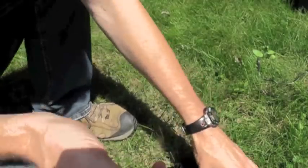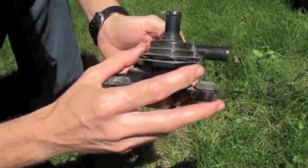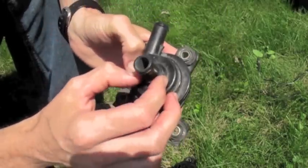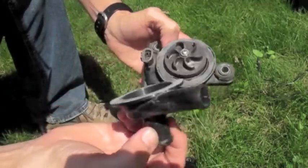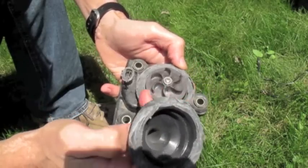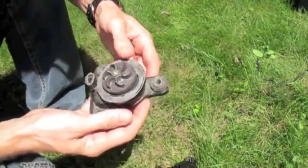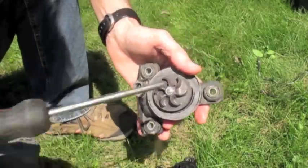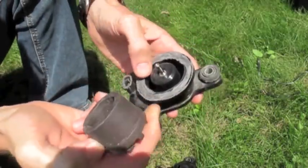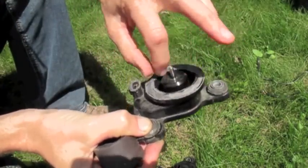Let's have a look at another one. I picked up two of them and I took one apart — I was curious as to what was inside. It's all thermally molded together so you really can't take these apart, but you can see inside there's a little screw that does hold something together. So I cut around here and took it apart. Basically in this little motor there's an impeller, and there's your input and your output holes. There's just one screw in the center and this slides out — no real brushes or anything in here. It looks like it's a thermally molded induction motor.